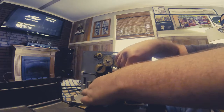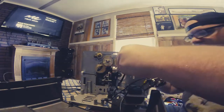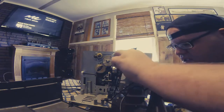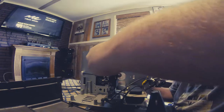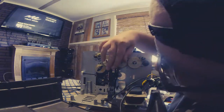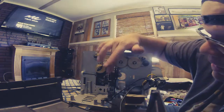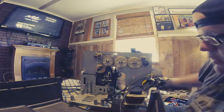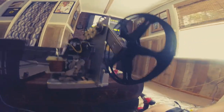You don't see this too well because my big arms and hands are in the way, but I'm feeding the belt around the motor pulley, then I feed it around the top pulley, then pull it around to the side pulley. Now I'm testing to make sure it's in line and it's on there — we're good. If it rolls freely, then you're good to go.